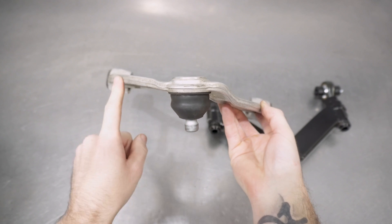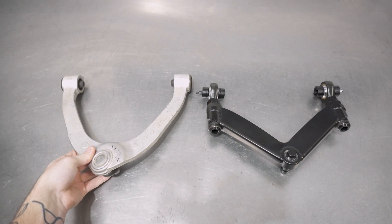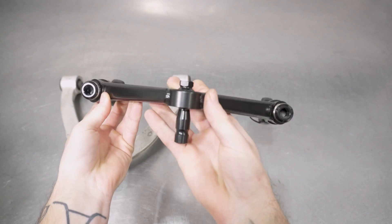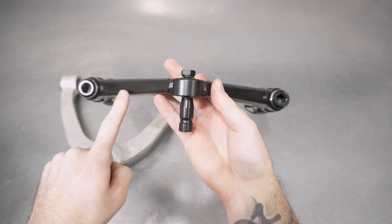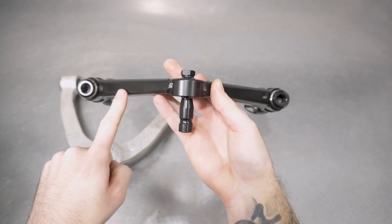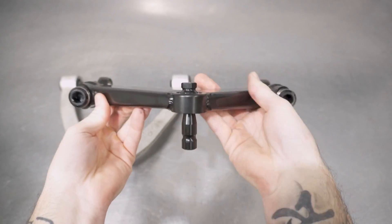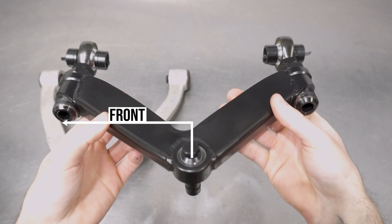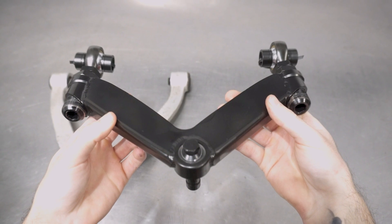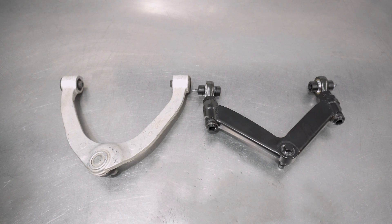You may have also noticed that your OEM arm came bent from the factory — thanks, Nissan. It looks like it's at an angle on the bench but it's straight on the car, while ours look straight on the bench but are tilted on the car. This is fine and nothing to be alarmed or ashamed about, as it has ample clearance on both bump and droop. One more important warning: these are, in fact, directional. If you install them backwards, you will risk bindage and or breakage. The bearing is offset from the inside of the V, meaning the arm on the left side of the car has the offset inner V facing towards the front on both sides. Get it? Got it? Good.